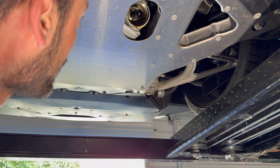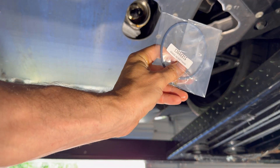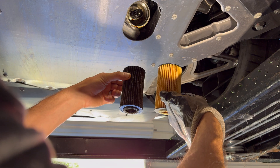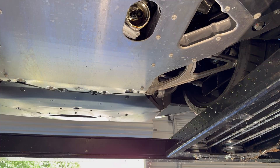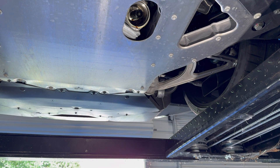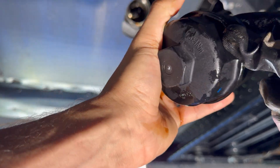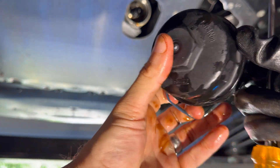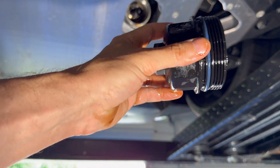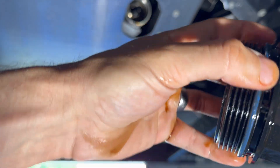Since we're over here, we'll just go ahead and do the filter first, then I'll do the rest of the draining. There's the O-ring part number if anybody can see. There's our new filter — identical to the old one. Now you can just take your little flathead and pop it off. We take the old seal off, put the new one on, and put a little oil on it. As you can see, it goes in that last little groove before you go over. It's already got oil all over it, so that's good.